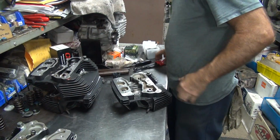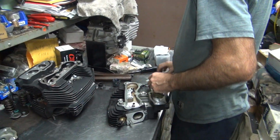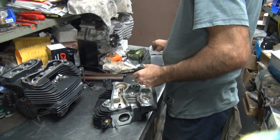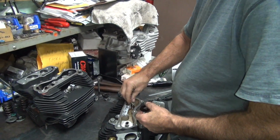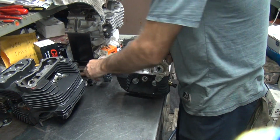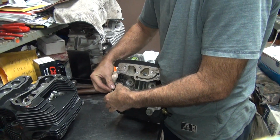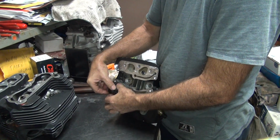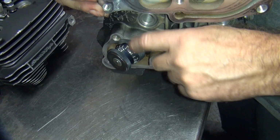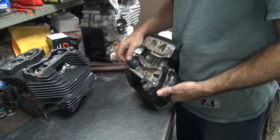Okay, this is the intake seal. So you got to take into account all of these numbers when you do them. There's still other stuff we got to do we haven't done yet either, but we also checked the valve clearances. Okay, I'm just going to put a 30 in here as a reference. Seems to be the magic number right now. We're over here about 97 and a half, 98, so we're good. So 30 is the number. We'll probably run 30 on all four of these.